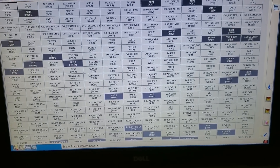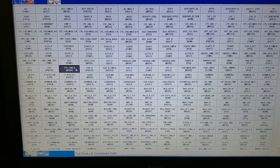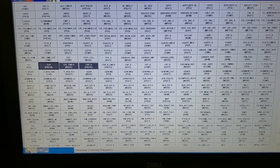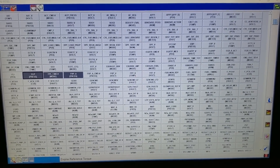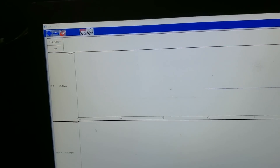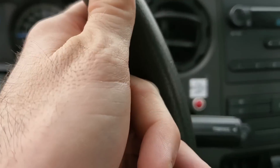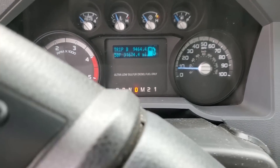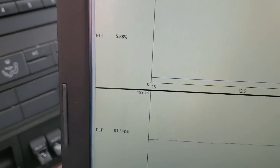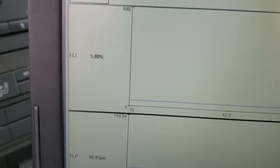I'm going to clear everything and I'm going to be looking for fuel pump lift command, FRP, and FLP. Right now, check out what we're reading. So we're going to see if we're going to maintain that 80 PSI while driving — if that rust you saw in the tank and that fuel sender was the cause of our concern. I have a low fuel warning on right now. This is a 40-gallon tank and I put two 5-gallon fuel cans in it. So 40-gallon tank with 10 gallons on there — IDS is indicating that's about almost 6% of fuel.